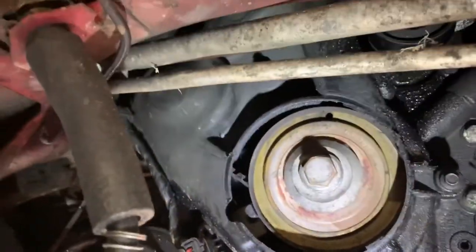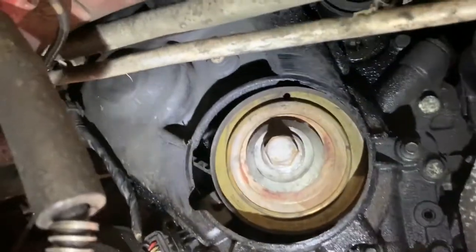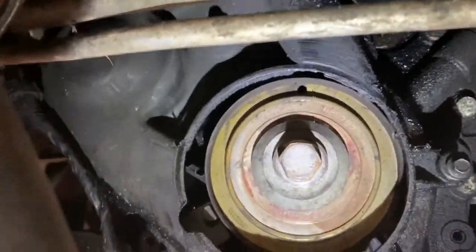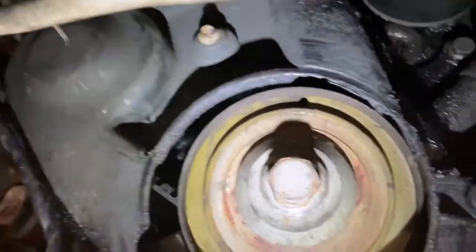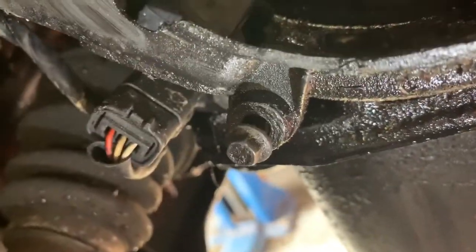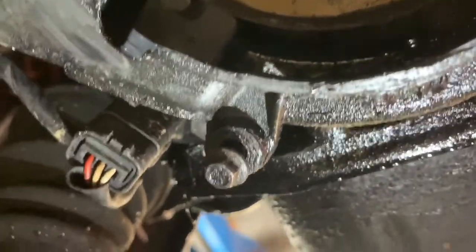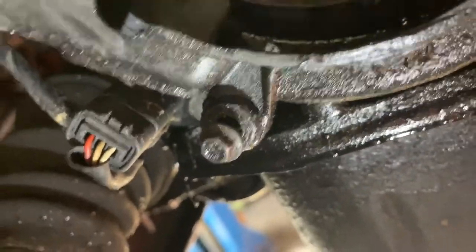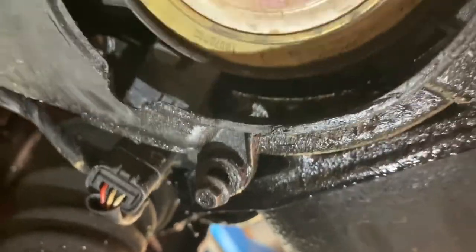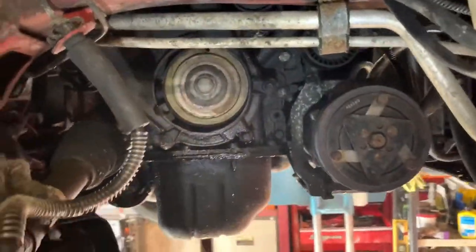And I can also confirm you can't get this cover off until you've got the top cover off. So I've now got to go back up the top and get them out. Also another little handy thing, these bolts don't actually come out of the cover. So if you're undoing them, you just need to wind them till they go sort of wobbly and loose, and then they won't fall out, so you won't lose them. So that's pretty handy. Well done, Peugeot.